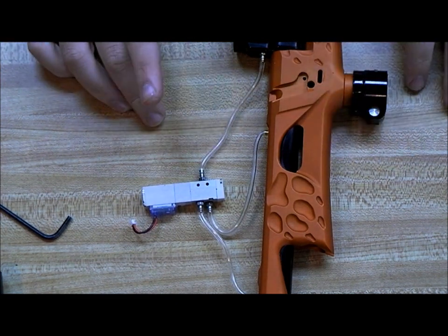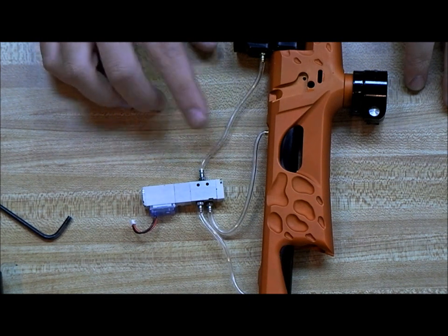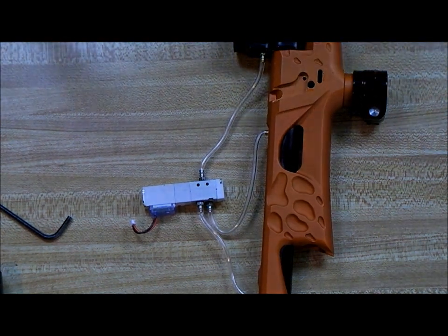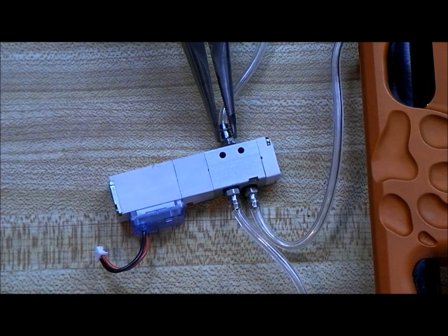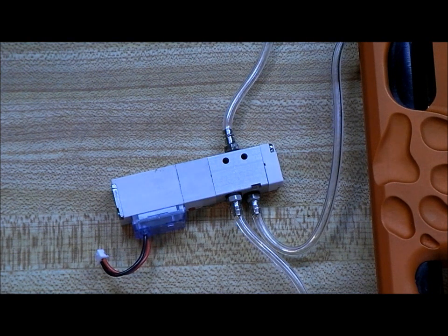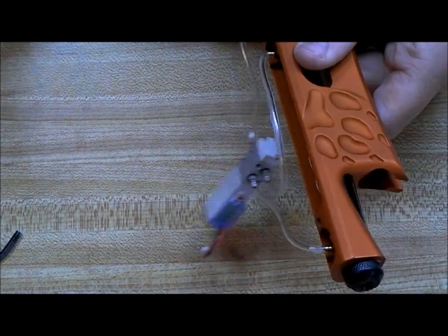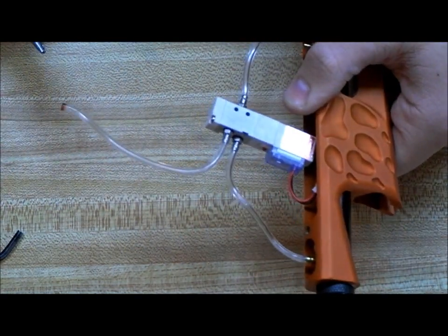The easiest way to bust a barb, besides over-tightening them, is trying to pull the hose off with a pair of pliers. All the time you'll see people grab the barb instead of the hose, and when they go to pull it out they'll bust the barb. These are nickel-plated brass — these are high-flows. The easiest way to do it — we'll start with the RAM sleeve — is you grab the hose and just pull. You grab the hose and you'll be able to advance the hose.